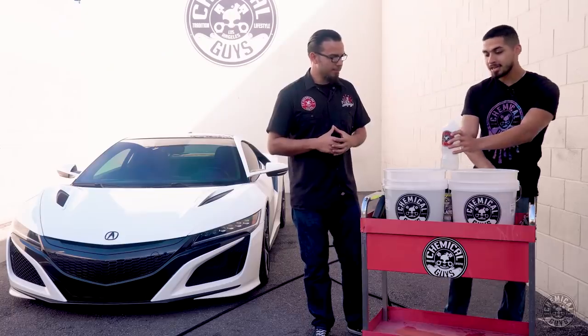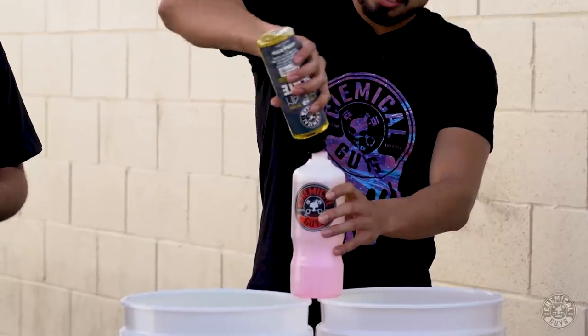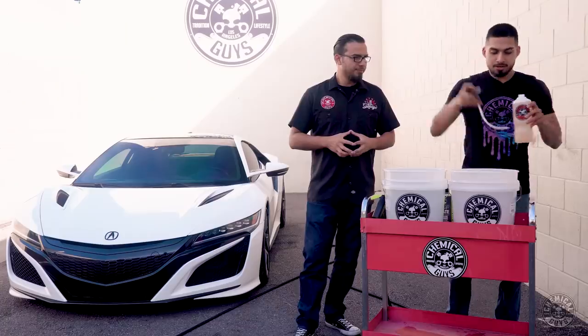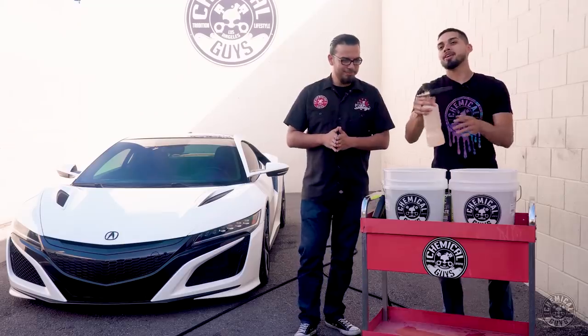The reason why I have Mr. Pink and Clean Slate: one, Mr. Pink is going to foam up a little bit better. Clean Slate doesn't really foam up at all — it's going to add extra lubrication, extra cleaning power. So simply apply one ounce of Mr. Pink and one ounce of Clean Slate. This is going to ensure I remove any glazes, sealants, waxes, or ceramics that might be sitting on the surface, so whenever they re-clear coat this car it won't be hard to bond. Put this little tube back on, and you'll go ahead and stir it — do not shake it, because if you do you'll cause bubbles. We want more water and solution just to be mixed in, less bubbles.